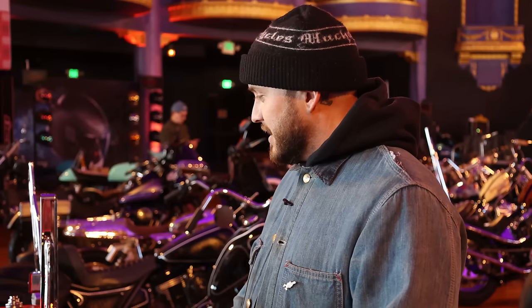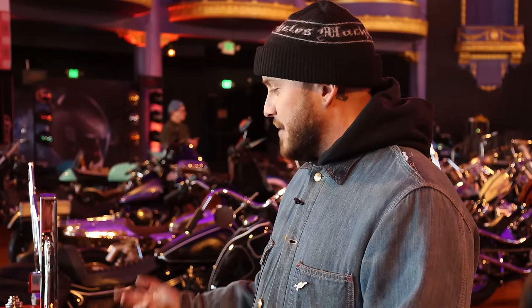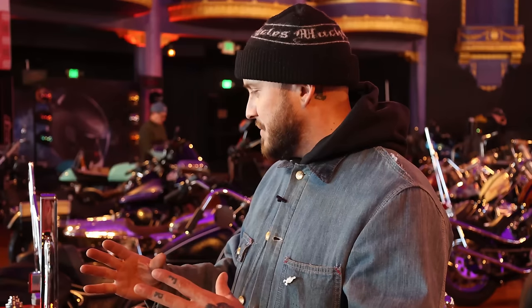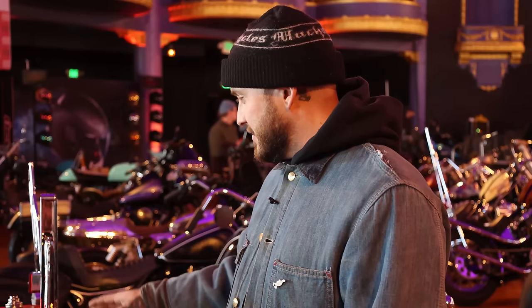Then this old military vet who lives right behind my shop in Ogden came over and gave us some tanks one day, and this was one of them. It was probably almost three times the size width-wise that it is now. The second he brought it over, I knew at some point I was going to use that for an auxiliary fuel tank. I later learned it's an old Briggs & Stratton tank. I cut about the same size that it is out of the middle of it, then welded it back together and shrunk it all down to fit the application I was doing.